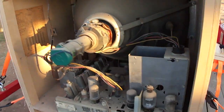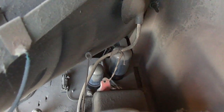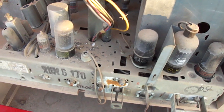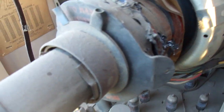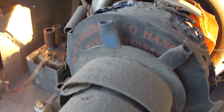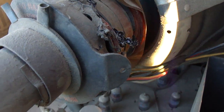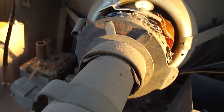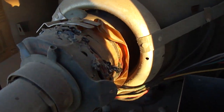This is a pretty high performance set. It's got a lot of tubes in it. The rectifier tubes and power transformer are up here. It looks like this plastic on this yoke is really disintegrated. I'm not sure if there's really a fix for this. If I could maybe silicone it or just peel away all this busted up stuff — I don't know if it's bits of Bakelite or what it is — but I'll see if I can fix it.